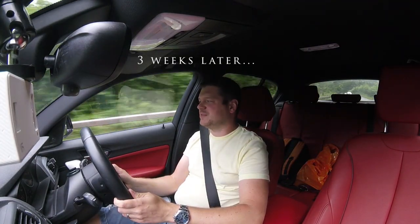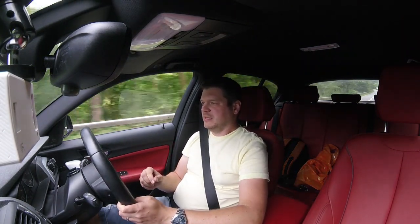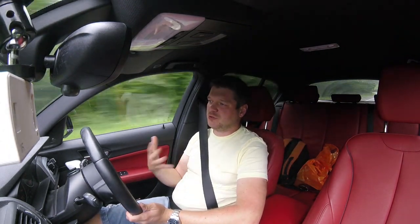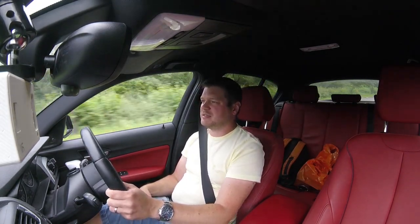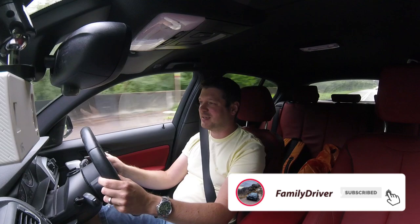After having a good hoon for about an hour and a half, I would say the brakes were definitely the right choice. The Ferodo DS2500 feel much more responsive than the standard pads — you've got that initial bite and a nice feel when braking, and you don't have to push nearly as hard. Definitely worth upgrading. Big shout out again to the guys I bought them from — check their website as they were cheaper than eBay. See you in the next video, thanks for watching!